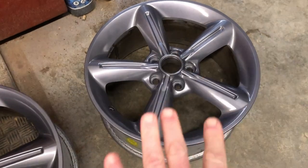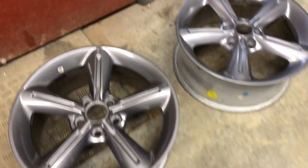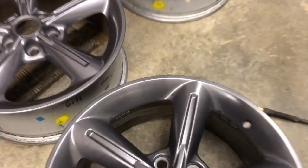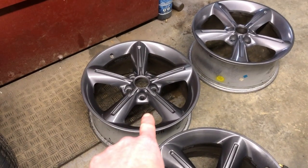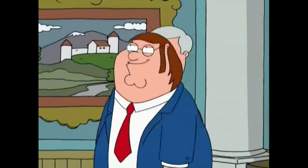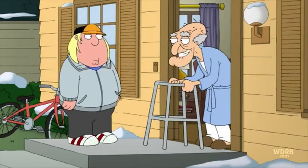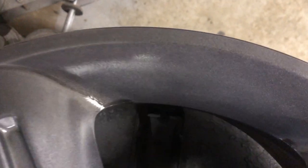These two wheels are the first two I did with the first can of paint - turned out really good, paint went on smooth, clear coat looks grand. This one I did with the second can of paint - the paint did not lay out as well, I developed a little run right here, and the clear coat has had a bit of a reaction with the paint. Same clear coat both times - paint mixed probably a couple years ago on the good ones, freshly mixed over the weekend on the bad one.